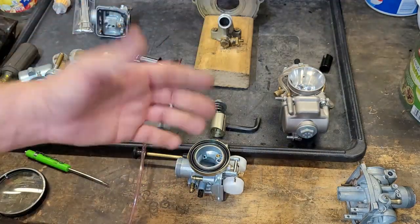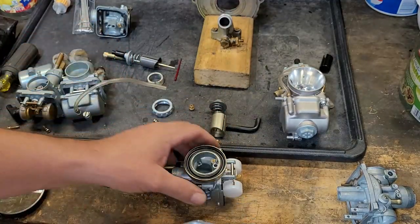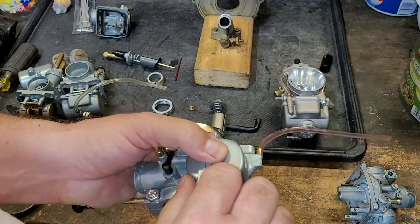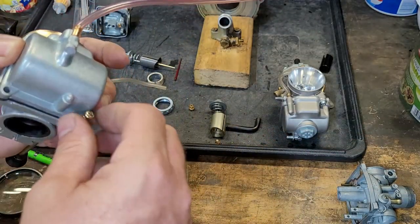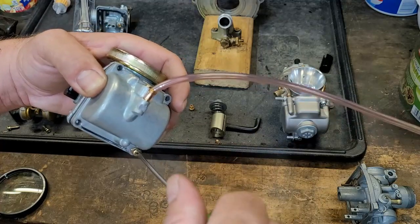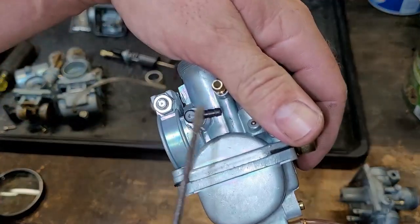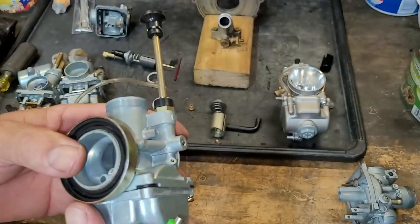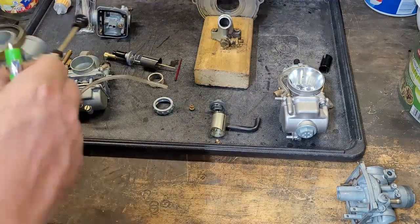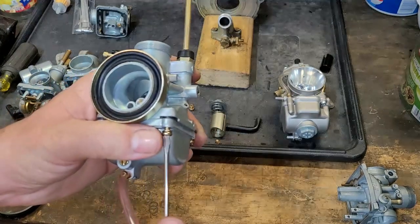So we actually have a pretty decent carburetor right here — this thing's going to add some performance to this bike. I do have to clean it; I have not cleaned it yet. It is not a bad carburetor at all — will it work? Absolutely. What's the major thing we have to do? We have to clean it first and we have to cap that little black piece. Other than that this carburetor is going to be just fine. We just want to make sure we have adequate fuel flow, because with a big jet and a small bowl — that's one of the cons — the smaller bowl.